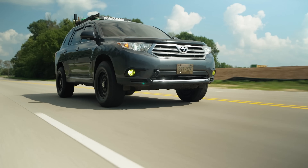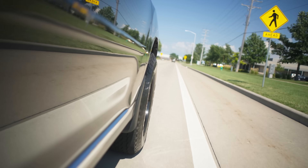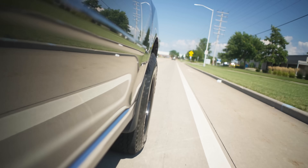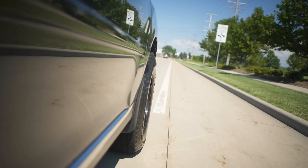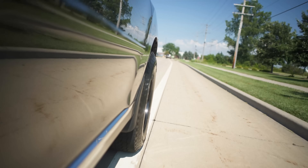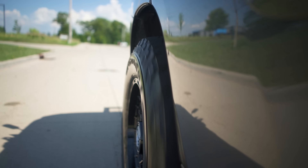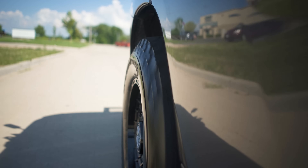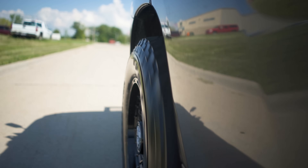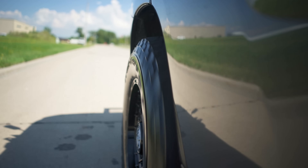The RTs are great, especially LT-rated ones. If you have a pickup truck or overlanding vehicle — whether it's a Jeep, 4Runner, or Tacoma — for handling all that extra weight with an E-load rating, you're not going to have to worry about overheating the sidewalls or overloading the tire's weight capacity. Whereas passenger-rated tires are going to be a little more sensitive to how much weight you can actually put on them.